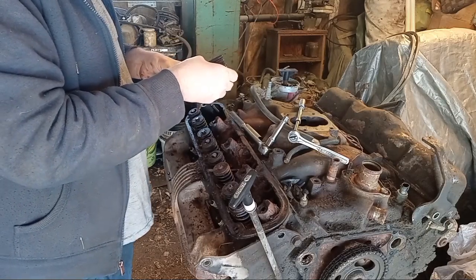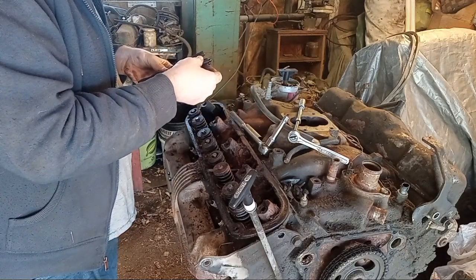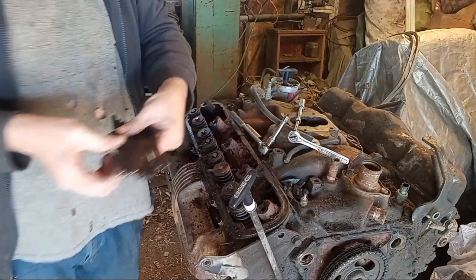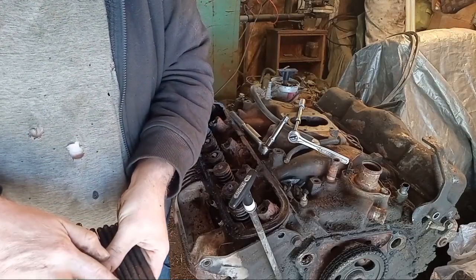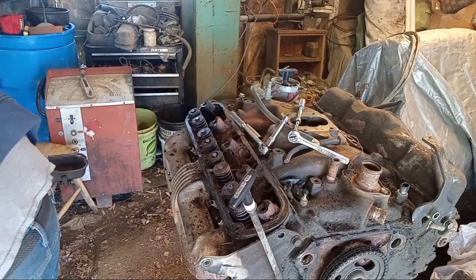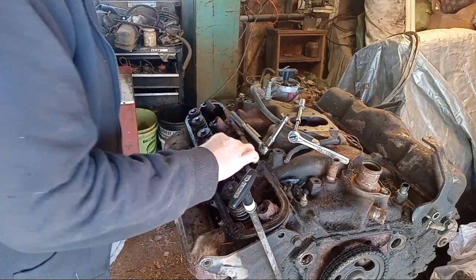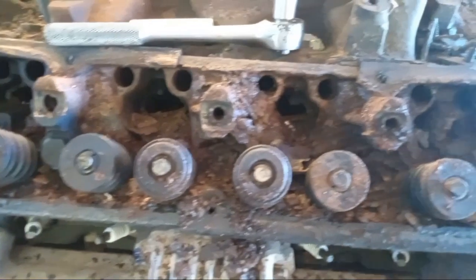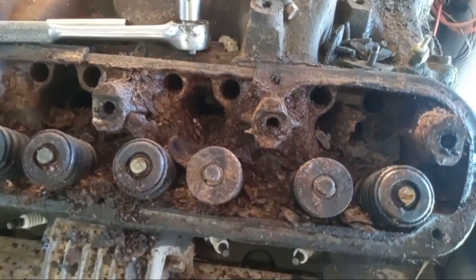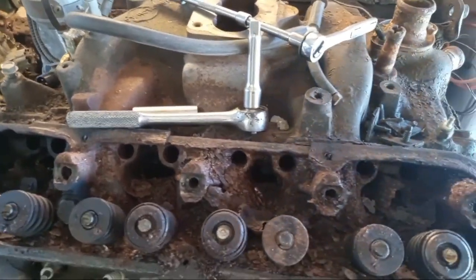The moisture is more prevalent toward the front of the motor. None are bent - they're just very rusty. This is the front of the motor, going toward the back. We were starting to get oil through them, which is good. Look at all this flaky rust and stuff. Holy Toledo. These heads are going to have to come off regardless. I was hoping that maybe we didn't have a stuck valve, but I was already planning on it, and the valves seem to be on the same plane.